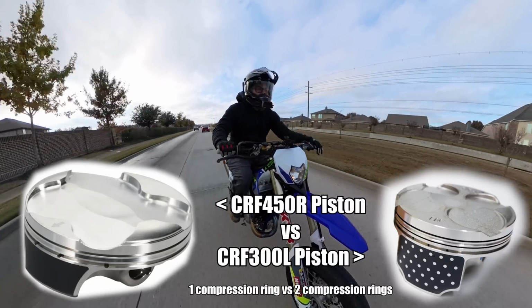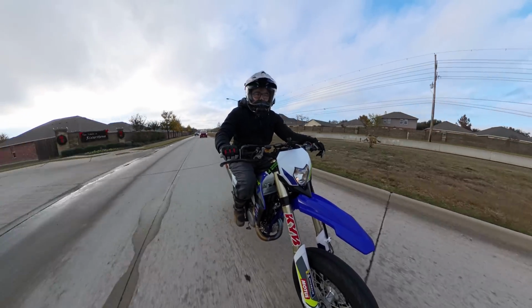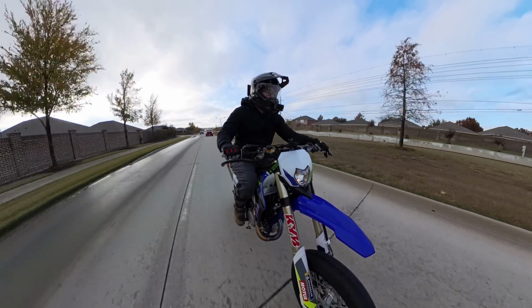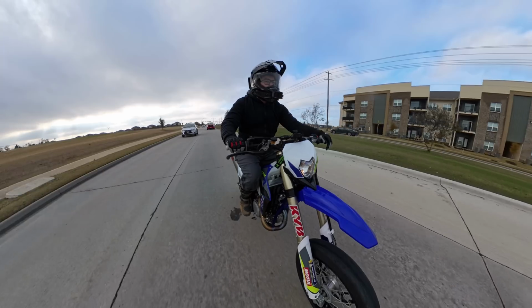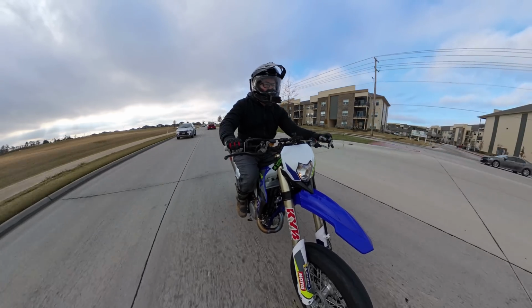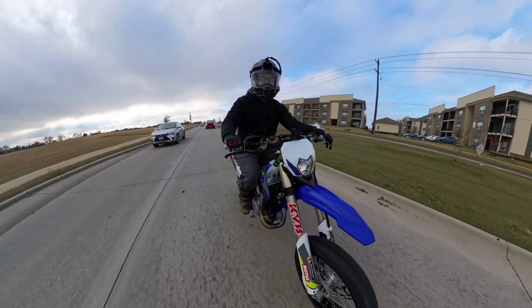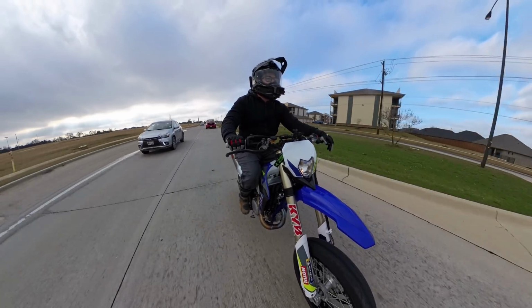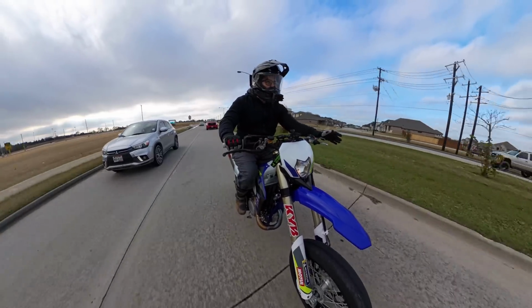That piston has to change direction real fast to allow a faster revving engine. And the downside of that would be faster wear of the piston and cylinder. You get more rocking in the cylinder. So I think that's a possibility. Are engines like these less concerned with the vibrations they have, so they're not as balanced and counterbalanced as well as things like the 300L, and those vibrations over time wear things down a little quicker, right? That sounds like it could be a thing, right?